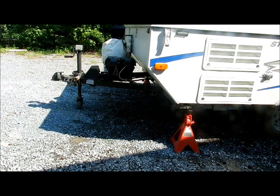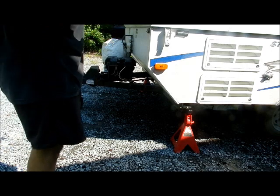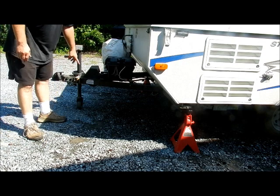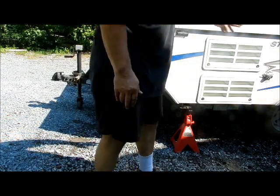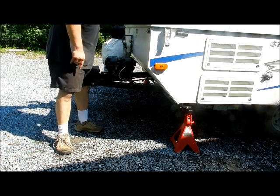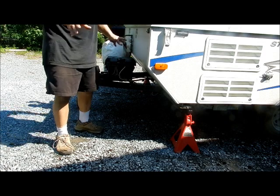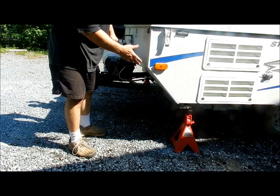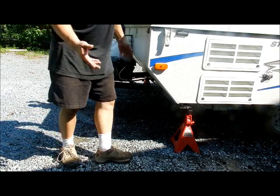Alright, not a problem. So what we need to do now is we have scissor jacks we have to actually start doing all the adjusting. The nice thing that we have, though, is 5 things that are going to stabilize this. This wheel is going to actually have weight on it. That's going to help stabilize it on this side. Then you're going to have 2 more here. The only thing that came with this was 2 stanchions in the back and this wheel up here. That didn't do any stability. This thing wobbled when people were inside, and it was a very poor night when somebody would be moving on one side and it moved the whole thing, at nighttime. So putting 4 jack stands on it and the wheel just makes it a lot better. It's more stable.